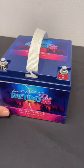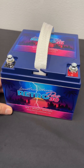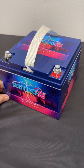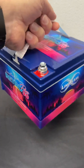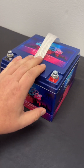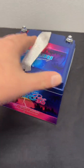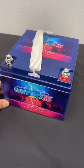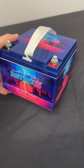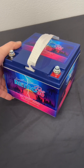Now we've got this guy — the Retro Pro 30 from Limitless Lithium. This is an awesome unit. You definitely do not want this battery paralleled with any regular AGM or stock battery. You want some sort of isolation relay in between those two to protect them from one another. It's relatively lightweight, but kind of like the XS Power Titan 8 Plus, this is something borderline enthusiast or the everyday street guy who really wants to push about 4,000 to 5,000 watts continuously on a daily basis. It doesn't want to see a charge over 15 volts, standard for a lot of lithium batteries nowadays. So this is your borderline going from normal everyday street banger into something a little more serious, without all the crazy electrical upgrades.